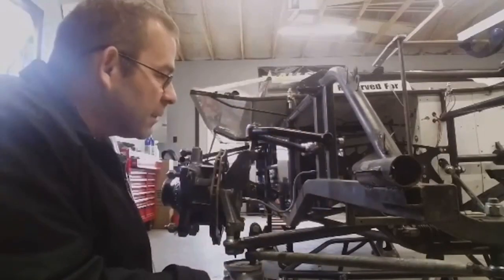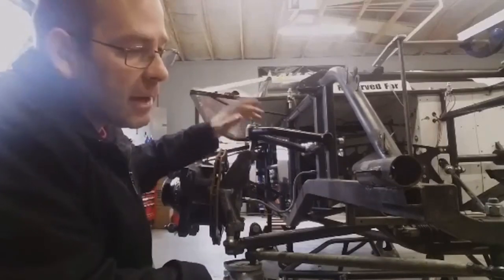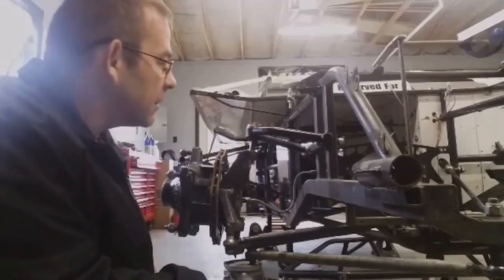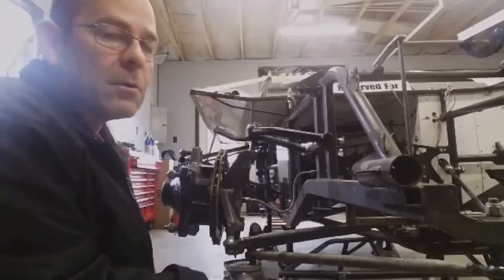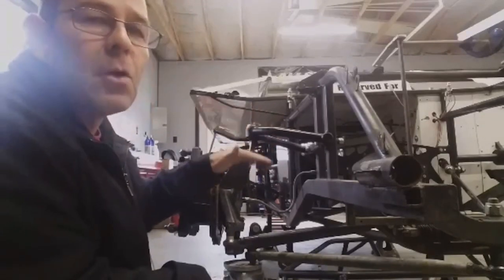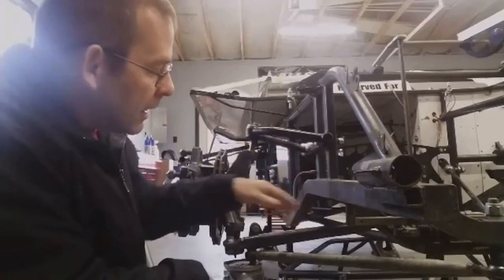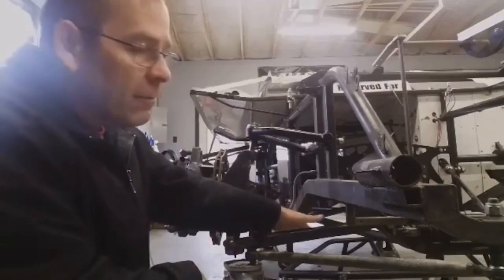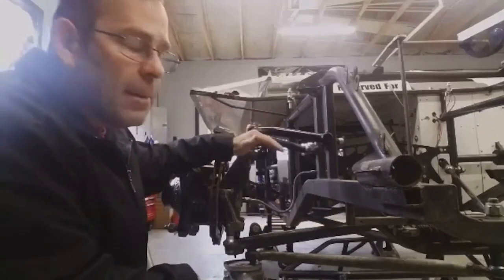Chassis builders come up with a roll center for a reason — they give you part numbers for your ball joints, A-frames, and other components for a reason. Sometimes when you just throw something on there, it gets you in left field because it's not the right part and it moves the roll center, caster, camber, or other settings. On the 2020 car we're probably going to run the roll center just a little bit lower. We're going to drop the upper control arm mounts down and bring the lower control arm mounts down about three-quarters of an inch, so the lower control arm runs level rather than uphill and the upper runs a little more downhill.